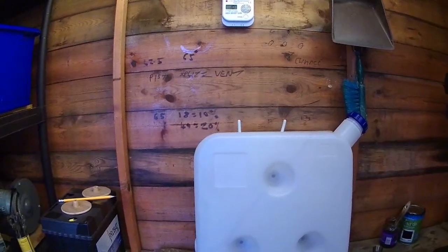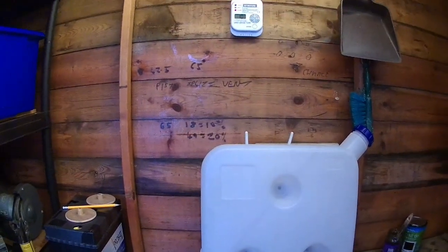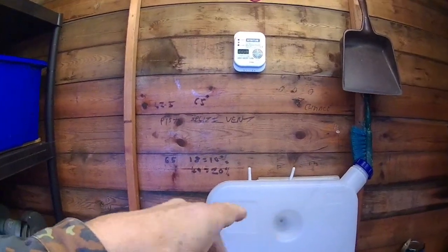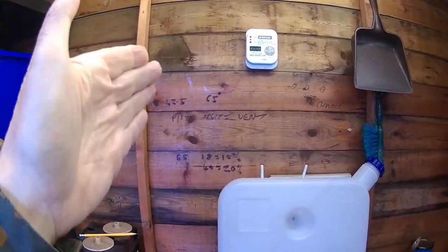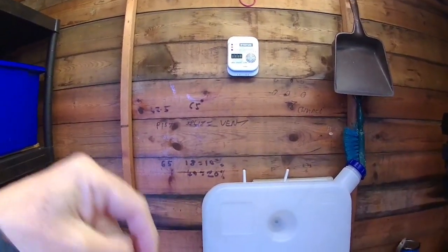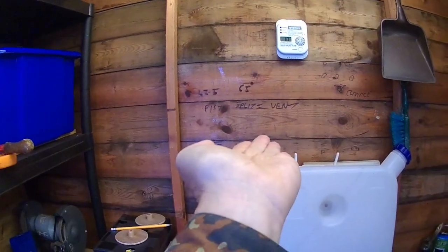The only last thing I can think of is, oh yes, the silencer itself. I've mounted mine flat, horizontal. Sorry, I haven't got one here to show you. On the side there's a drain hole, and you're supposed to have that drain hole facing downwards so you don't get a build-up of moisture in your silencer. It runs out of that little hole in the side, where the crimped edge is. You'll see it if you look at it. So it shouldn't be flat, it should be that way.